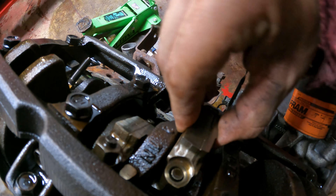Pushing all the rods down so they don't hang up. Brad doesn't plan to reuse this crank. Cylinder three's bearings were completely stuck to the crank — totally worn. Cylinder four's bearings went completely bye-bye — RIP cast crank. Then realizing that means we have to pull the head off too.